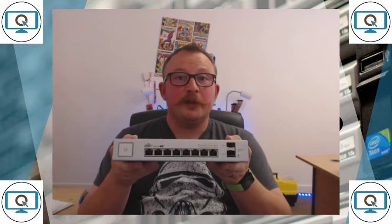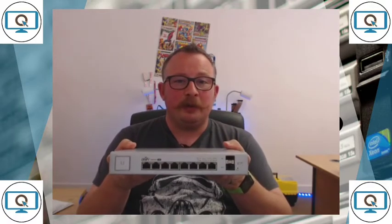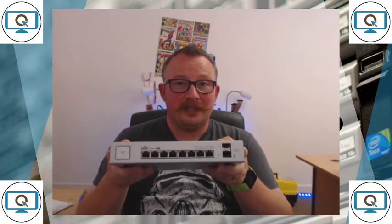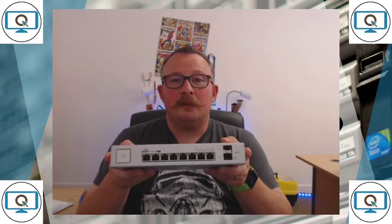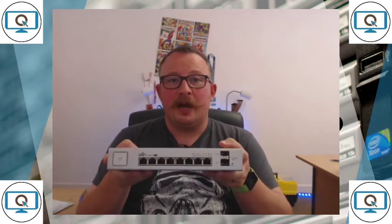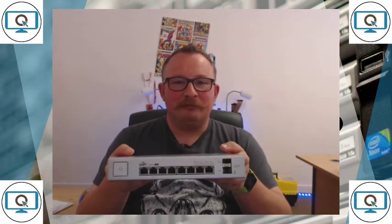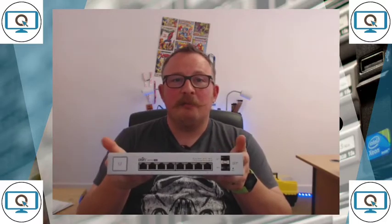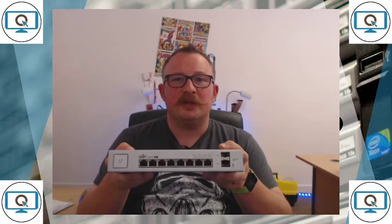Obviously that's not ideal when your wireless network's not working. They were moving people around so that devices could get into range of the wireless, but moving people around in a care home during COVID is not ideal either. So I went to site, fairly quickly established that the problem was this exact switch — a UniFi switch which had failed. Fortunately I had spare switches with me. I swapped it out for a known good one, fired everything back up, wireless worked, day was saved, and people were able to contact their families again.